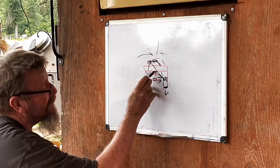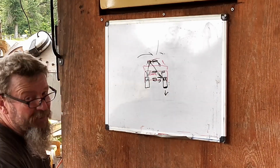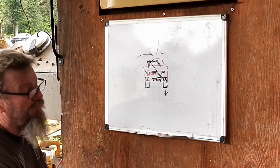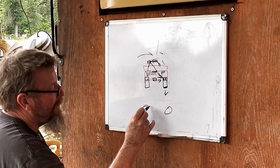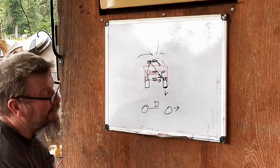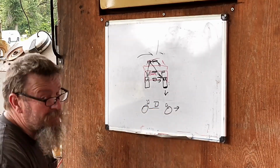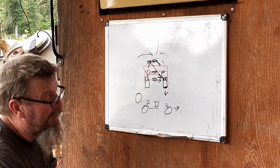That's also why this can be more in the middle. I'm not a big fan of putting a whole bunch on the right, unless maybe your car's built with a lot of left side weight. Sometimes in some sport mods that I drove that didn't turn well, we put left side weight, just in the front, but more toward the center of the car. And I am a fan of trying to keep your weight in front of the rear wheels, behind the front wheels. If you can keep it all in a small area, that's even better yet.